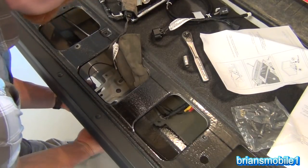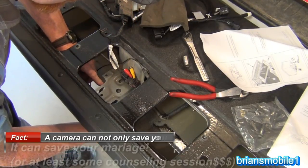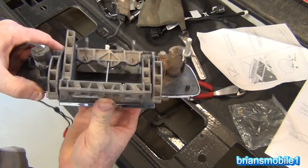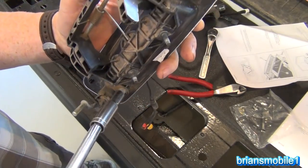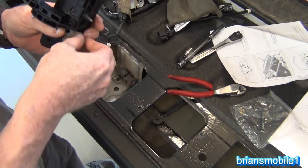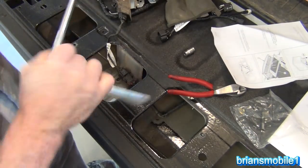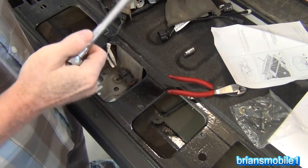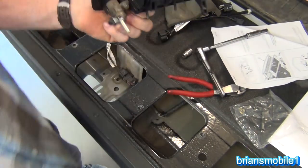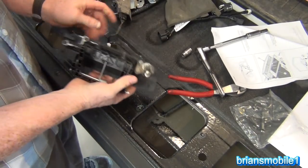Now I can get to our tailgate handle. I officially no longer have a backup camera or tailgate handle. I just rotated the tailgate handle down like that to clear this — that will get in your way. Put in the key cylinder; 8mm, you've already got that set up. I wish everything working on cars was this straightforward. These are cutting threads all the way in — expect a little resistance. Everything was going so smooth there for a minute. Look at how much dirt and crud gets in this tailgate — been doing a lot of dirt roads lately, that's why.